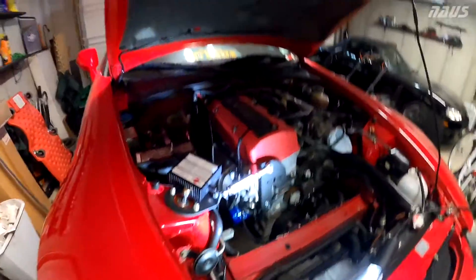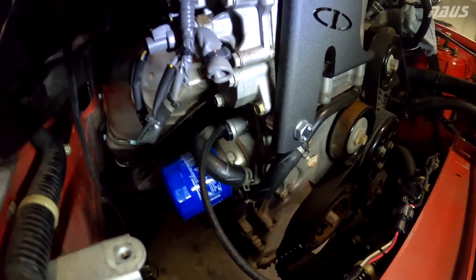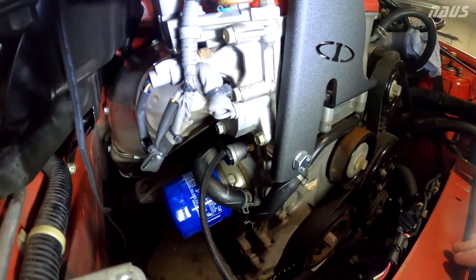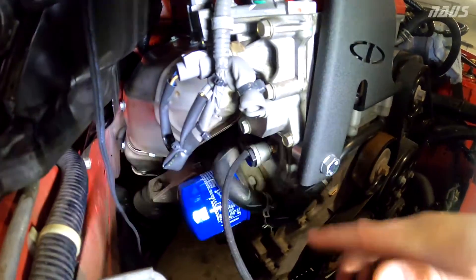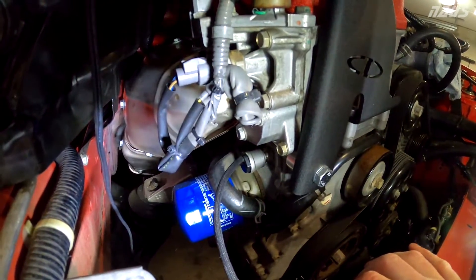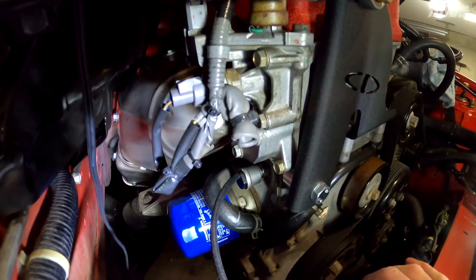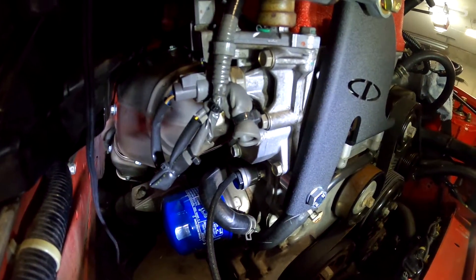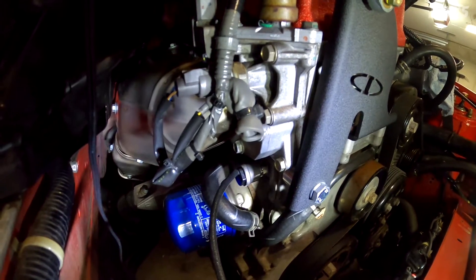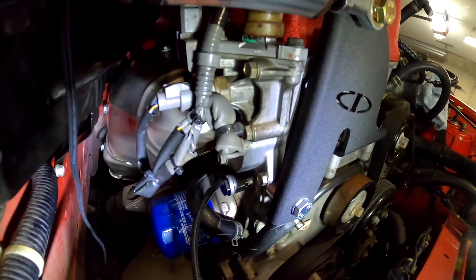The problem that some people told me about online is where I have my oil pressure sensor — the DEFI sensor. The main reason I ordered the DEFI product is it looks great, it's quality, and a big reason was the thread on the end of the sensor is 1/8 inch BSPT, the British pipe tapered thread, which is exactly what the S2000 block is. However, the only thing I didn't think about is that these sensors are very sensitive to vibration. It's a digital sensor — there's no mechanical pressure going back to the oil gauge.